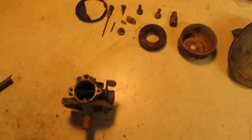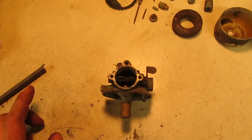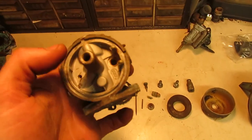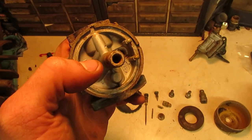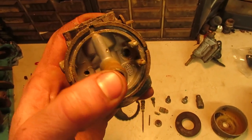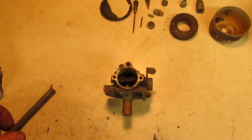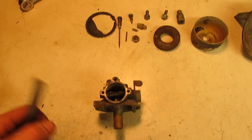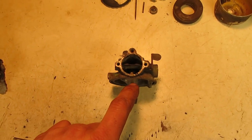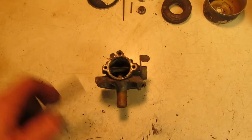But one thing I did want to note on these 8-horse carburetors for the Kohlers, and this goes for the same for the 6 and the 7s, is unlike the 10 through 18 horses, they have a removable main jet, but you can't do it with a screwdriver. It's not a flathead. It's pressed into the bowl stem on the bottom. So you can press them out, but you have to have a punch that fits the ID of the hole in the top of the bowl stem, which would be the OD of that jet, if that makes any sense,